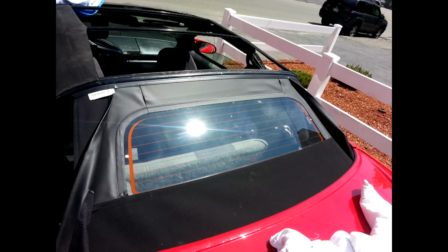It's not bad. Getting the adjustment of this rear window is the crucial part. You have to bolt the bow back into the rear deck two or three times to get the right tension of the rear window. You don't want it to sag, and you don't want it too tight. I actually got real lucky and only had to fiddle with it a couple times.